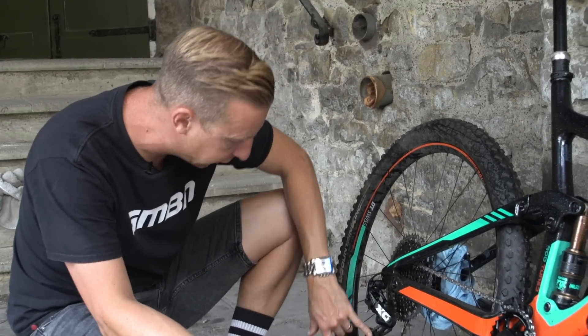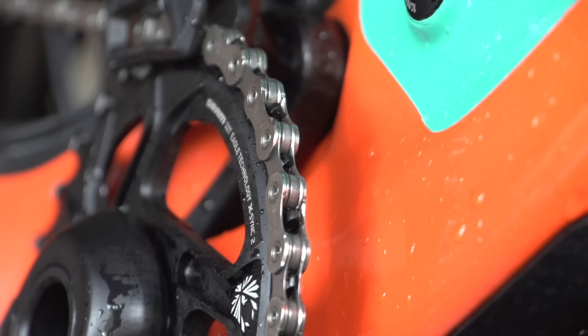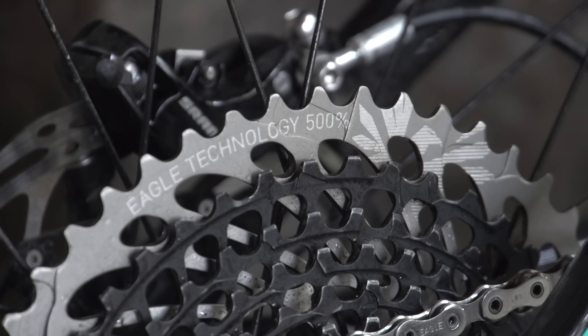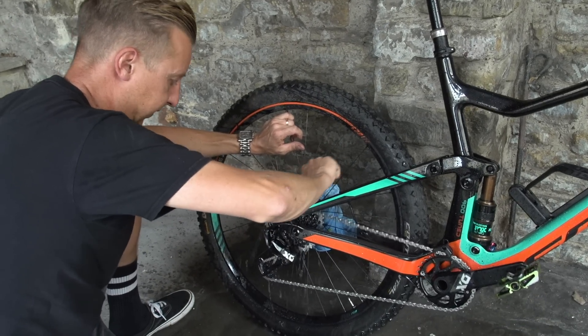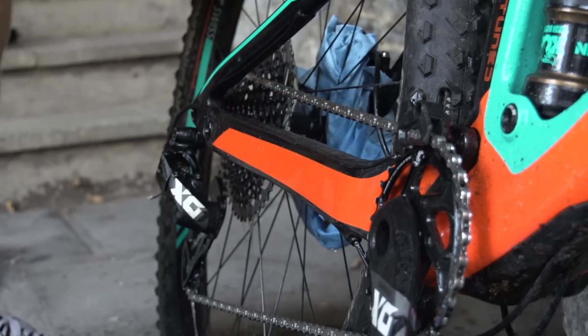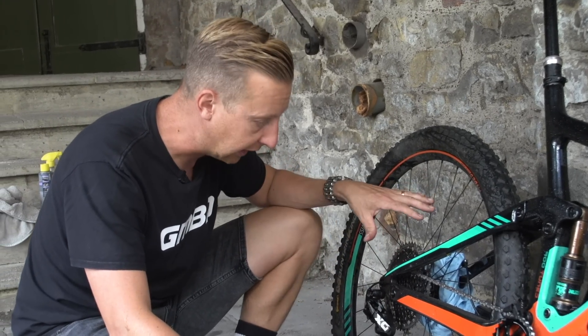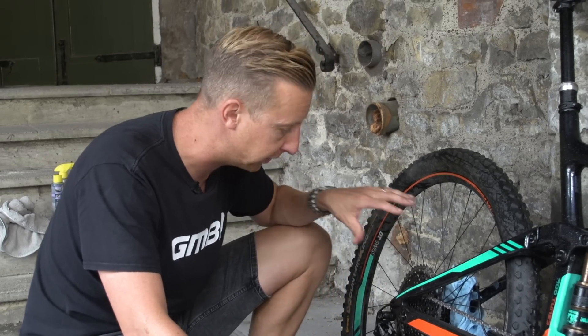I'm fairly happy with that — the jockey wheel and the guide wheels both look clean, the chain is looking clean, so is the chainring, and the cassette looks great. So it's time to just give it a rinse off, make sure there's no more degreaser hanging around. You don't want it to work its way into bearings like the bottom bracket or the main pivot or even a chainstay pivot. Make sure it's nice and clean and then give it a bit of a dry down or leave it to drip dry, then we'll get it up into a workshop and make sure it's fully lubricated and everything is in good condition.